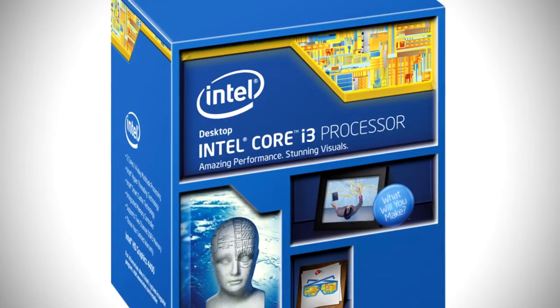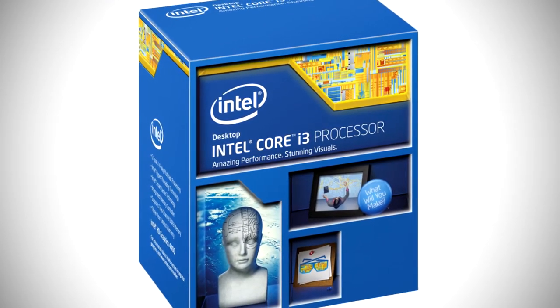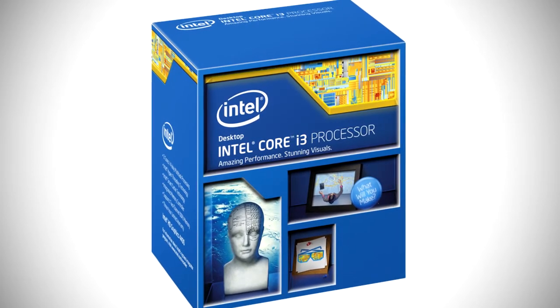Now we've got a case and a motherboard, we're going to need the brain, which is the CPU. For the CPU I've gone with the Intel Core i3-4130 clocked at 3.4GHz. You may be thinking: an i3, why not an i5? Well the short answer is the i5 is more expensive and the i3 is pretty good — it's not as bad as you may be thinking. It is only dual core, but with hyperthreading it is recognised as a quad core CPU. So running games will not be a problem. When it comes to video rendering it won't be as quick as an i5 or i7, but for this price range the i3 was the only option.